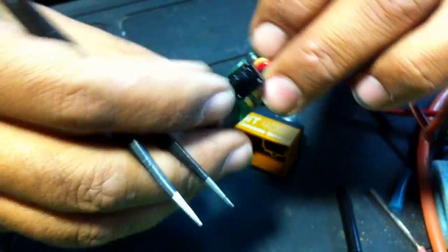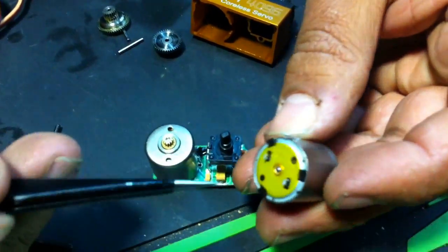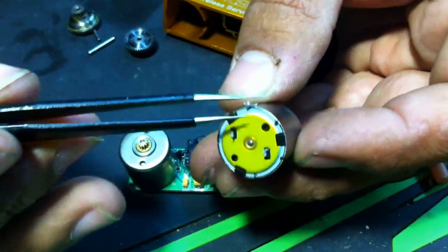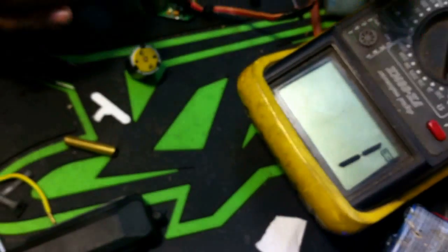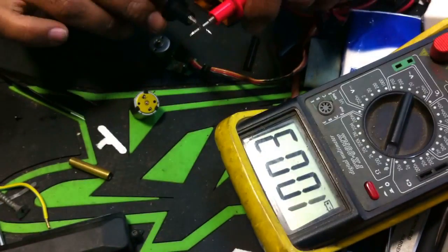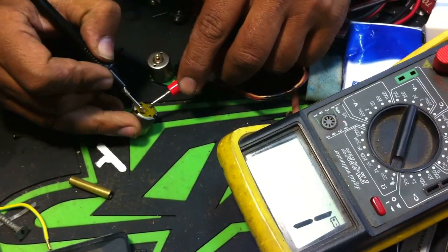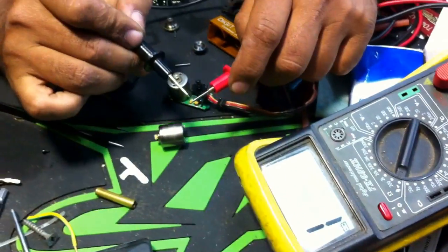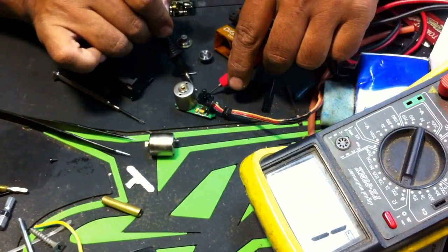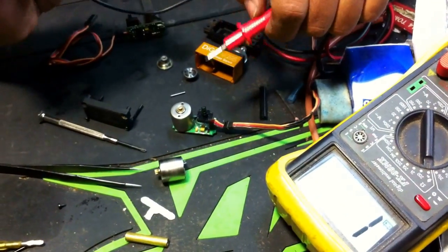I have somewhere else another motor — here we are. Here is the motor: this is the ground and these are the two pins. Now you can meter it, you can check if it's burned or not. You use this to see if we have a connection break over here — this is plus and minus. You see, it's dead. This motor is dead. If it sounds like this, that means the motor is okay and your board has a problem. So you can see if you have the motor burned or the board burned — this is the main thing.